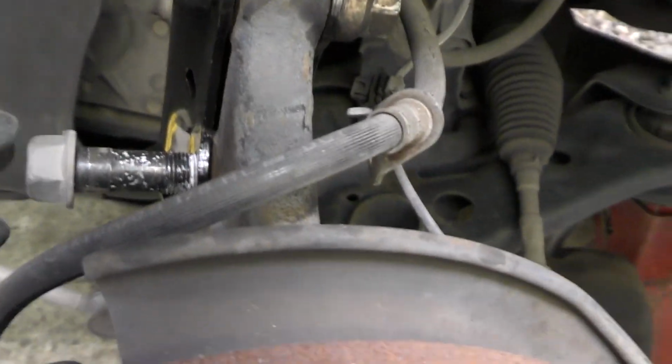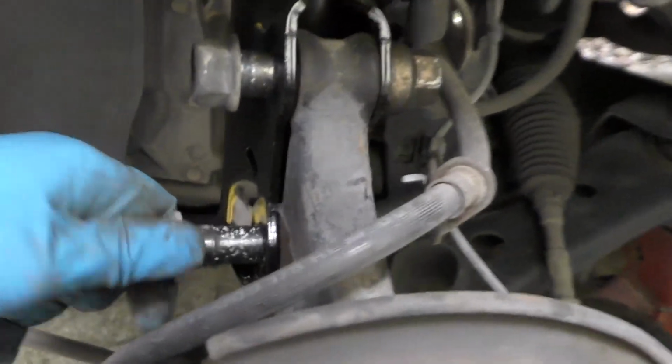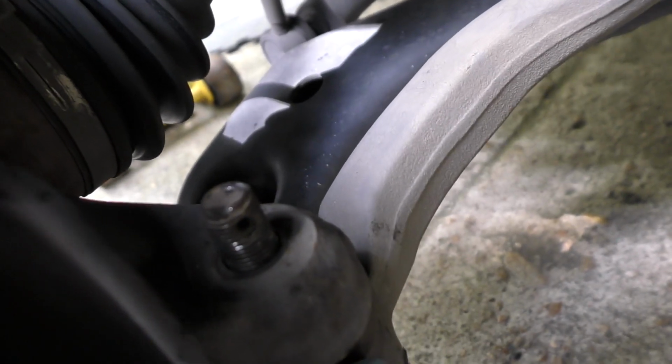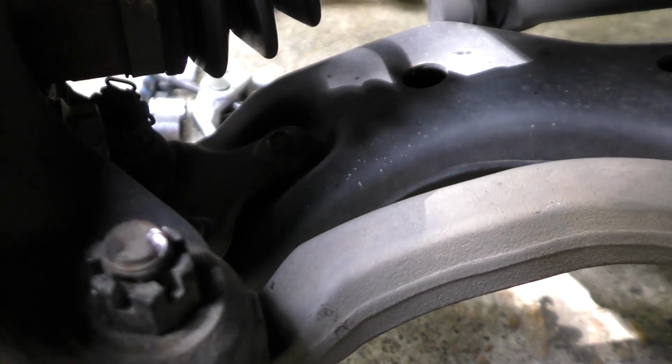Once you have the top one and the bottom one, you can wiggle it a little, and it's easier because the top's in and the bottom will slide in with a little jiggling and pushing. Again, you can do this by hand, but it's a lot more work. You get them tight, use a long extension bar in a socket, you'll get them nice and tight. Then bolt all the pieces on like the torsion bar bolt. Stick the tie rod arm back into its hole, you gotta do a wiggling, but eventually it comes up through the hole there. Then tighten the nut on top of it and put in a new cotter pin.